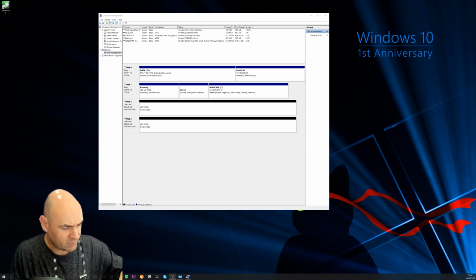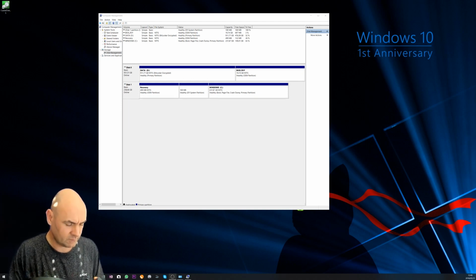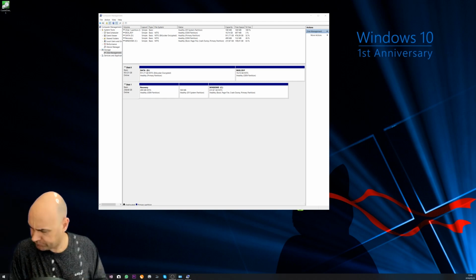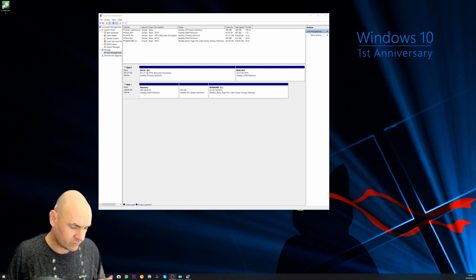Step 2. Refer to list as above, switch to the mode you want, then press reset button until the light of disk 1 and 2 is on. Okay, great, here we go. Out again. Click that off. And the mode we want is RAID 0, so 1 will be off, 2 will be on. That's what we have. Great.